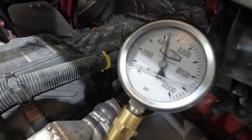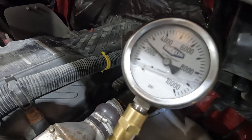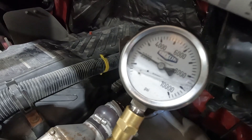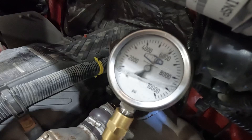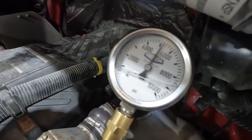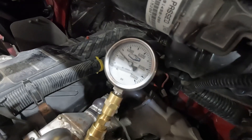6,000 PSI! Also keep the IPR full-fielded and watch for the pressure relief right here — it should be going down slowly like this. I have had some pumps that relieve the pressure too fast, and it created the same symptoms, so this is a good reference for you guys.